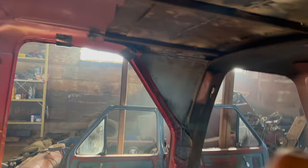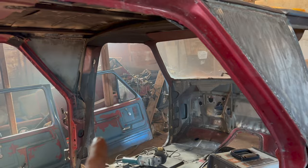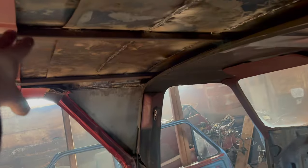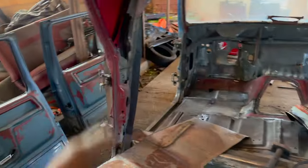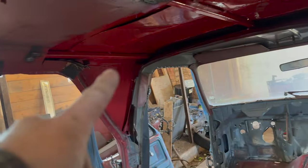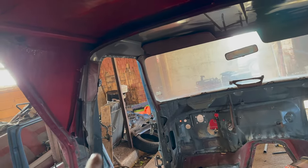What we gotta start focusing on is this intersection of the roof. We got a double wall inside here. What I gotta do is go out to the brown cab and cut the inner roof off that fella, because we've got to basically graft him into here. I'm gonna grab the saw and quickly cut that guy off. I painted it basically just in some cheap red spray can — just got to paint the underside, because once we put that inner roof structure we're not getting back to it. After, we're gonna seam seal the holes from underneath.